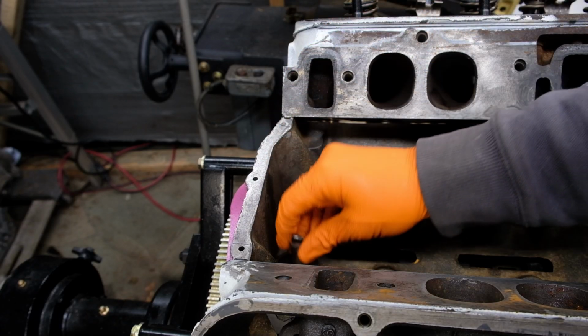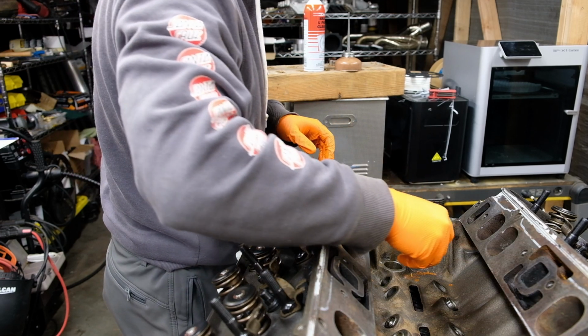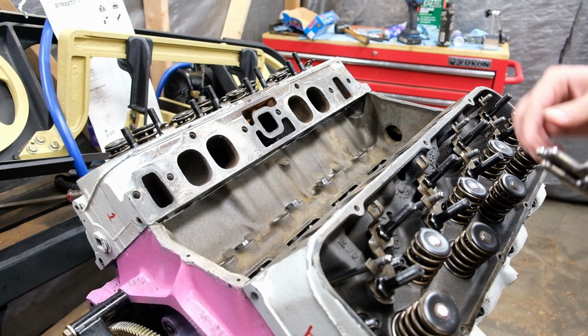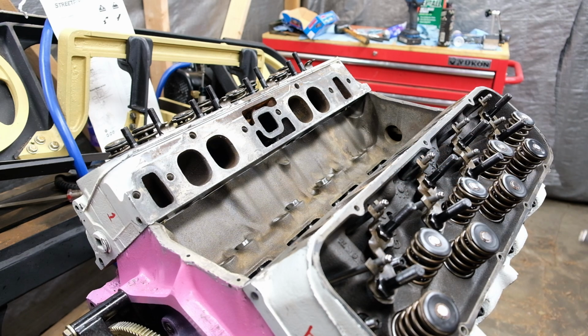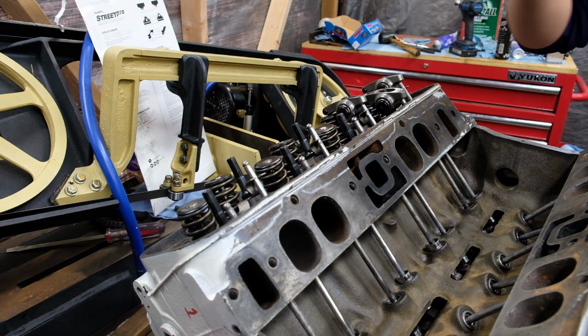Oil pump intermediate shaft goes in, and the lifters go into their bores extremely smoothly, unlike in the original build, when some of them were slightly sticky. The stock push rods are dropped in too after having taken a bath as well, and I'd wiped down all of my beloved Chinesium stainless rockers, but I'm not going to set preload until it's time to actually fire the engine when I get it in the car.